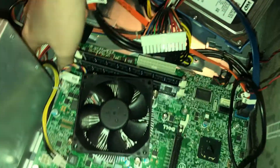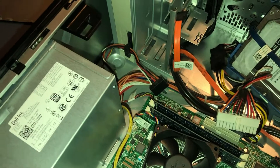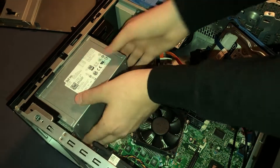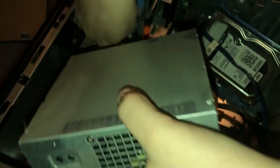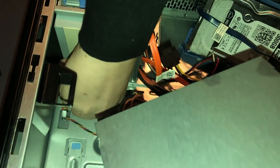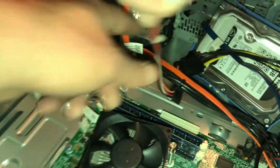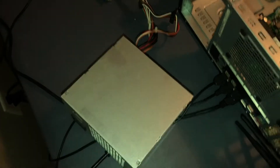Sometimes the power supply has a pressure connection where you have to push down to remove it. What I do is stick a screwdriver in to hold it down — just press down and push. Now you can lift the power supply completely out. Be careful not to touch anything inside. Move the cables and anything still connected, and the power supply is completely removed.